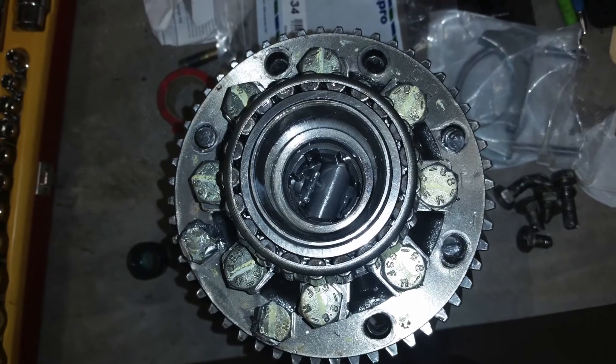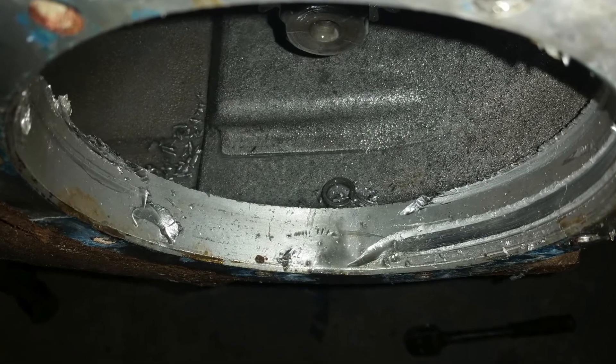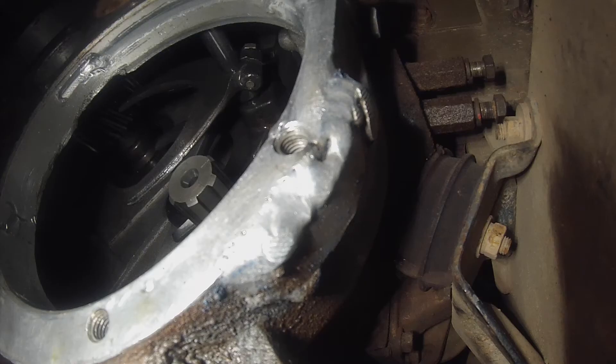This is the result of the carnage caused when the bolts holding the low range gear to the differential housing had started to come loose, probably because they were never Loctited on assembly. Some of the bolts are snapped off, although they mostly undid themselves, got chewed up in the speedo housing, and then blew through it. It caused some cracking which I managed to weld up all right — the casing actually welds quite well.